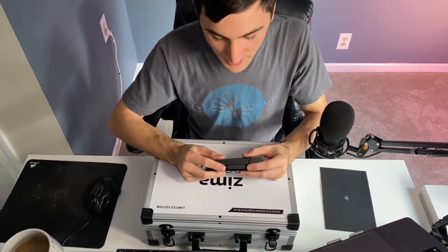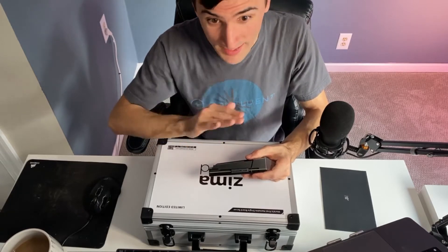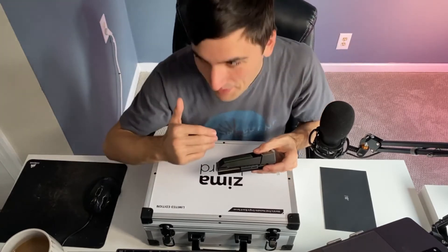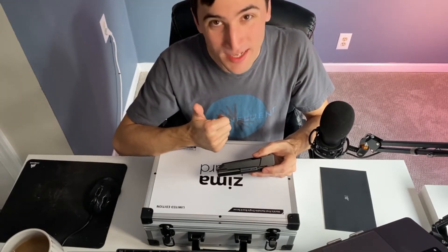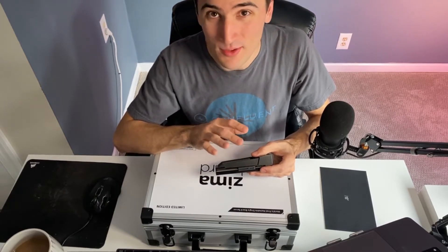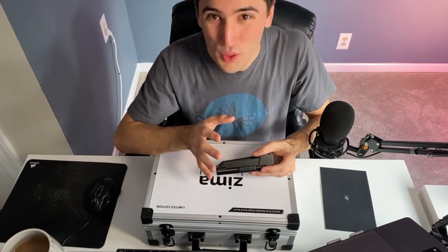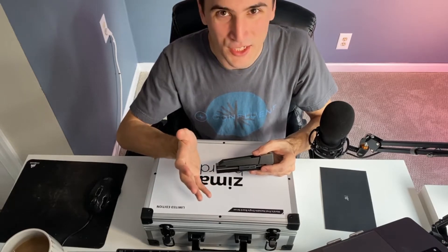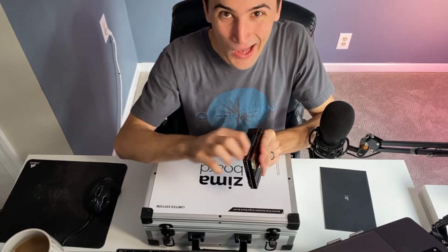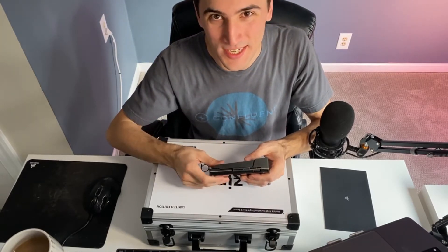This is honestly one of my favorite parts: it's a PCIe Gen 2 slot with four lanes, so that gets you up to two gigabytes per second — gigabytes, not gigabits — of data transfer. That's super fantastic if you're doing Plex transcoding, ML accelerators, anything like that. It could technically support up to 8 gigabit Ethernet ports via expansion. The PCIe express slot is also cut off at the back, so if you have a full-length PCI card you want to use, you don't have to hack anything up — a super cool attention to detail.